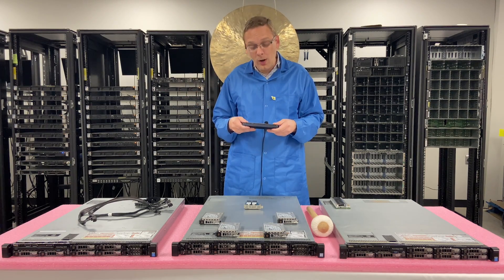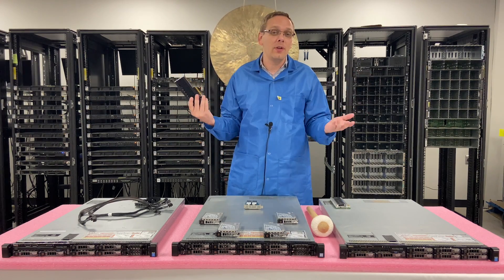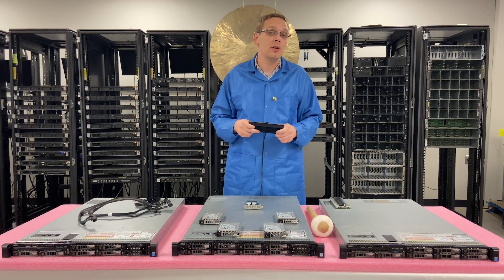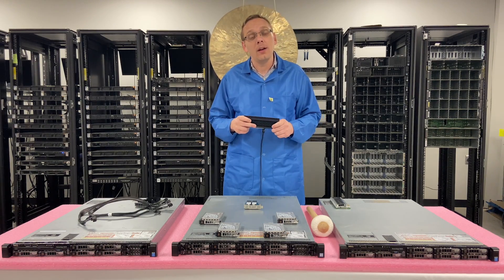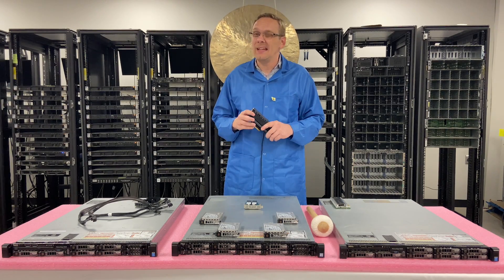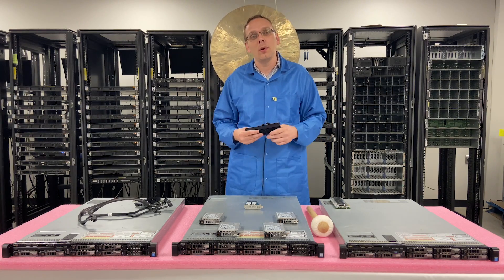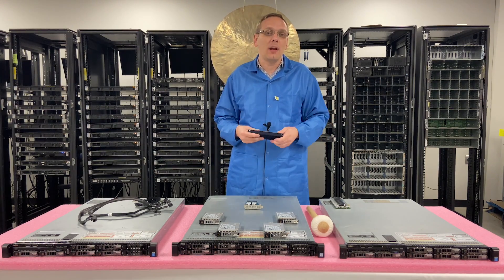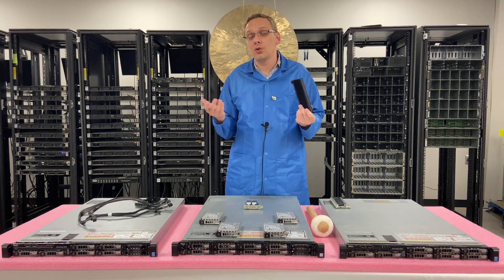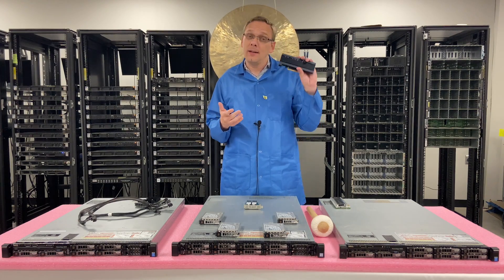The one way you can actually see the PCIe NVMe is if you go into BIOS under the device configurator settings — you will be able to see it there. But there are a lot of limitations with the PCIe version: you can't put an OS onto it, you can't make a virtual machine out of it. Really, all you can do with it is extra storage. So it's great as extra storage, but that's it for the PCIe.